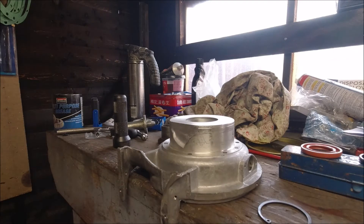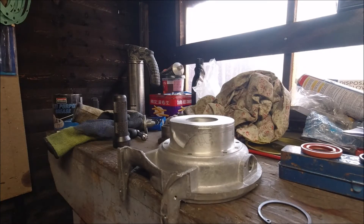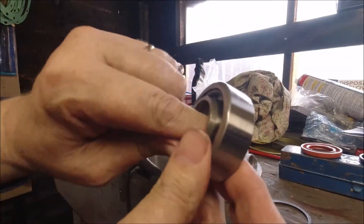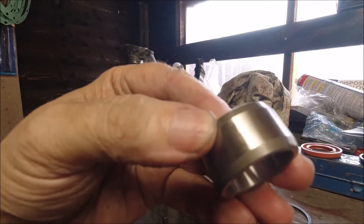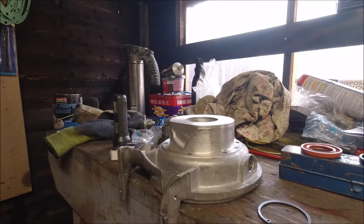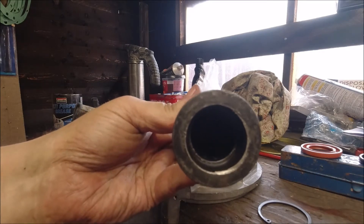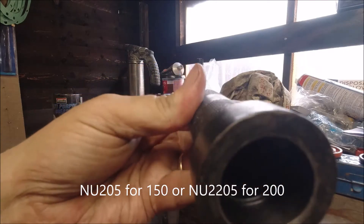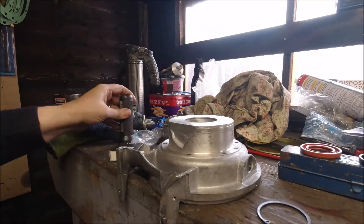The good old mag flange — good bearings are worth their weight in gold. This one on the mag side has got a bearing liner which goes on the crank. That center part comes out and goes on the lining of your crank. On the 150GP they're not as wide as these, and there's a special tool with a hole in it. Apparently the dance grips — the metal grips popular in the 80s — are the perfect size for it. That's a SIP tool made for it.